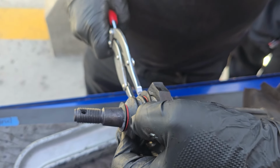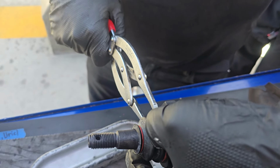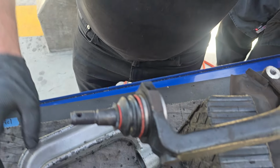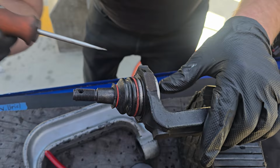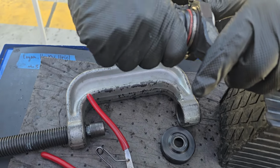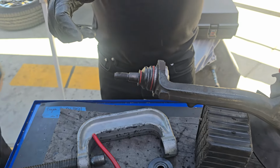which takes a little bit of coordination actually, because I'm trying to open that ring up as much as it can, and you see it gets a little wild on you. Okay. But when I get it close, sometimes what I'll do is just give it the final little tap here. Okay, looks like it's in. Make sure it's in the groove all the way around. And then actually this ball joint's in. You see how much tighter this one is. The other one was sloppy.